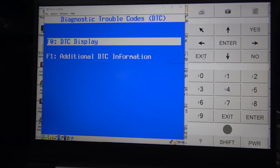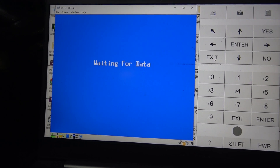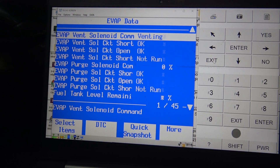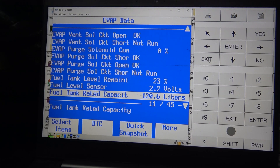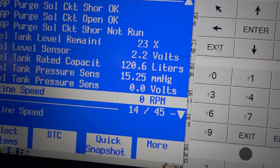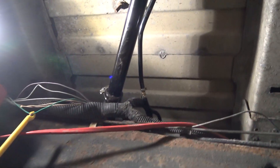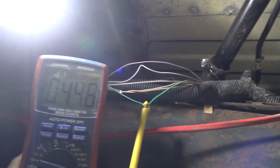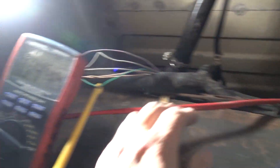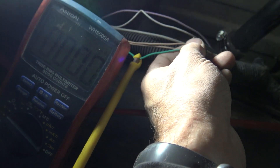If I could go back and do this diagnostic again, I could have done it faster. The vehicle was up in the air on a lift — hard to open a door, I got all kinds of excuses. But here's what it comes down to: if I would have left the scan tool plugged in and watched the voltage as I was horsing around with the wires, I probably would have found the problem a little bit quicker. I ended up probing into the gray wire, making sure I had my five volt reference at this easy to access point. I also checked on the green wire, which is a signal wire, to see what the voltage was. I had zero volts — or maybe about 30 millivolts — on that green wire, and I should be expecting around a volt or so, and we didn't have it.